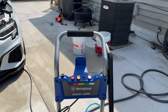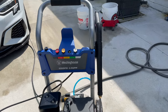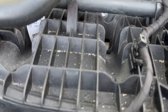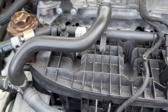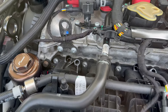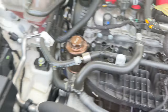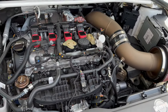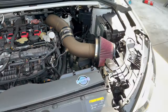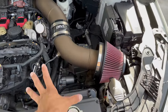The pressure is definitely up there — I only used the 25-degree nozzle, I could go down to 15 and probably get a bit more pressure. I should have done my engine bay and tried it with the 40-degree. I've got a bunch of salt stuck in there from my road trip back from north Texas over the winter — got caught in a snowstorm heading back to Virginia and my whole engine bay was covered in salt. I got a lot of it out, but getting that last bit is really hard — a pick is too hard and will scratch, a brush isn't stiff enough.